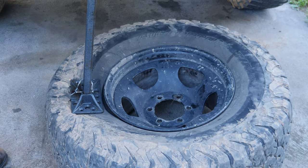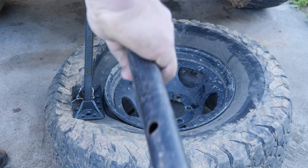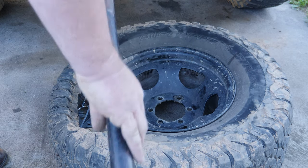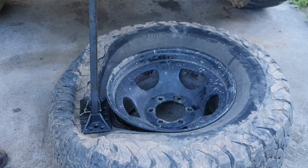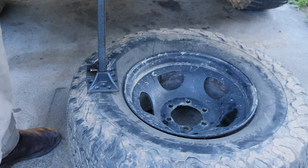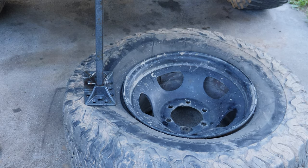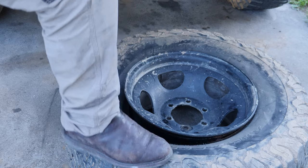And eventually it'll let go. There we go, it's letting go now. That side's done. We'll move to the other side by spinning the tyre around 180 degrees and push the bead off the other side — same process as before. Let's push on the sidewall. There we go, the bead's popped all around. So we're ready to set up to replace that valve.